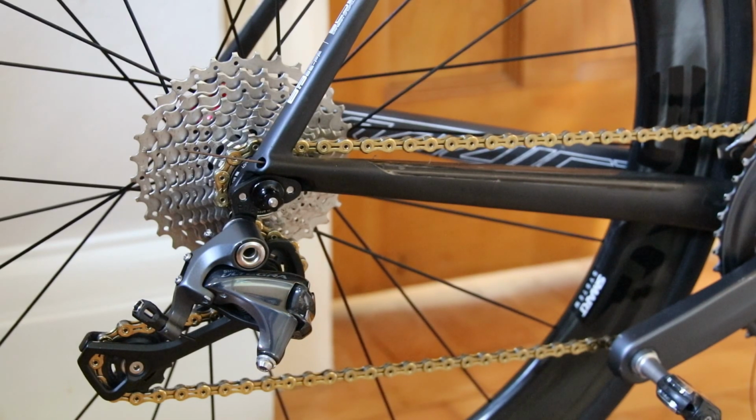First of all, I realised that there was a ferrule inside the frame. I wasn't sure whether that was an internal ferrule or an integral one, but it was just a plastic ferrule that had been stuck in there. So I got a quite long, thin brass screw, threaded that into the back of the ferrule and just pulled it straight out. It didn't take much pressure to thread it in, or much effort to pull it out, so I was quite pleased with that. I thought I'd mention it in case anybody else has the same problem with a ferrule stuck inside the frame: carefully thread a long screw in and pop it out. I used a decking screw. Even though I'd done that, I still could not get the cable to thread through.